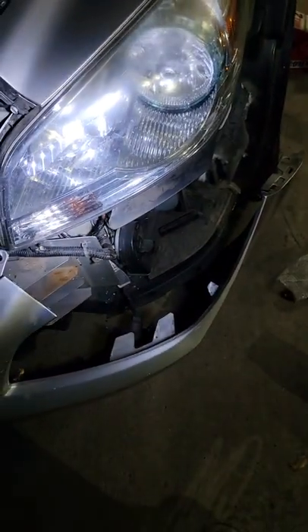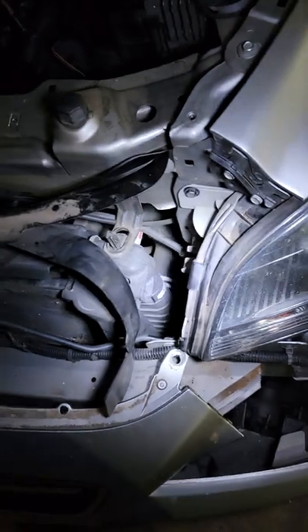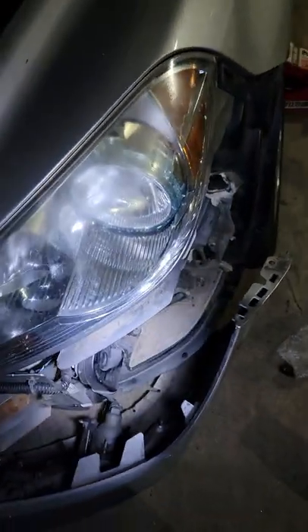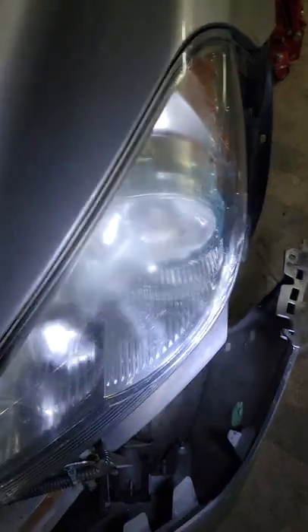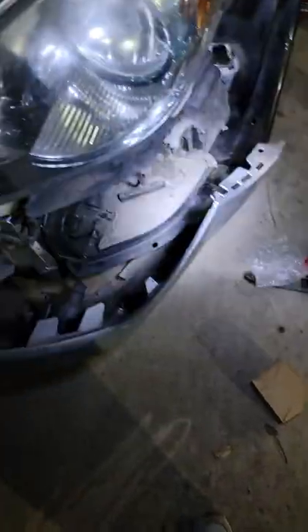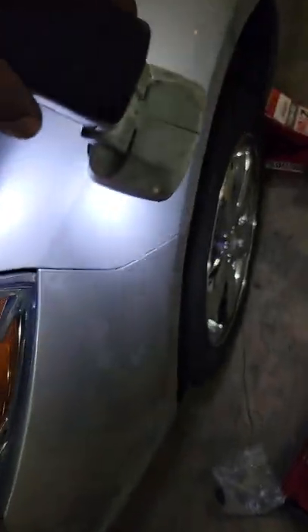As I've stated before, if you just need to change out the headlight, there is a way to just take this side loose, work your hand in, and take it out and replace it — but that takes a little skill. The normal factory way is to drop the bumper off, take some screws out. Since I've been in and out of mine, I don't even have all the screws in — just enough to keep it in place since it's an older car. We're almost back in business.